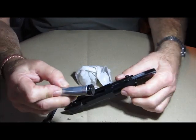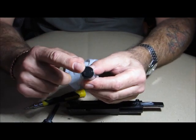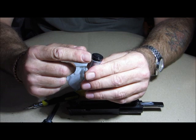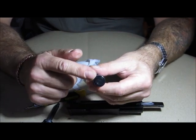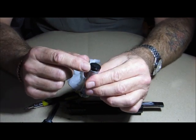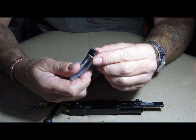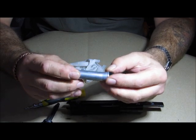On reassembly, I did some research into the best thing to put on the rubber seal — it was recommended that silicone grease is good for leather washers, and any synthetic oil for this type of seal. I used some car oil — Castrol Magnatec — whether that's right or not the gun seems to function fine. I probably didn't put quite enough on, because I didn't want the gun to diesel and have smoke coming out of the barrel.